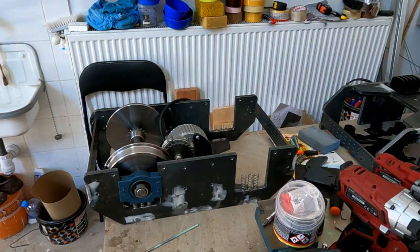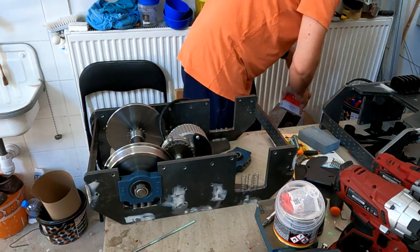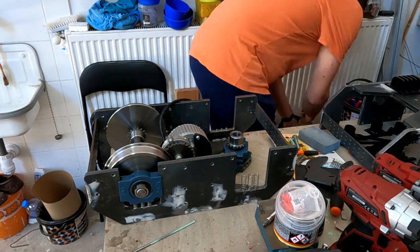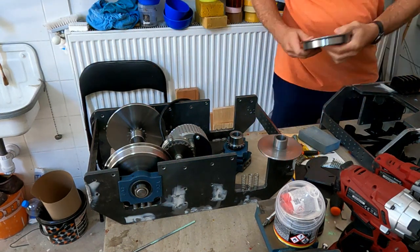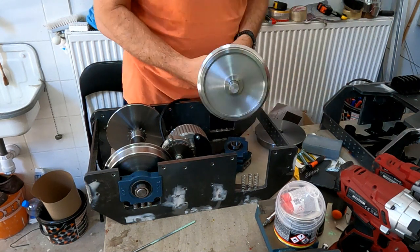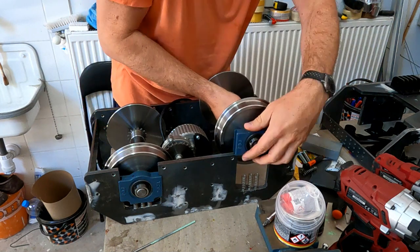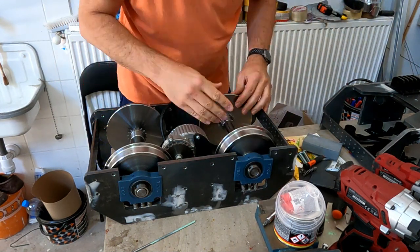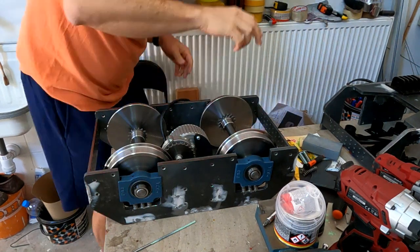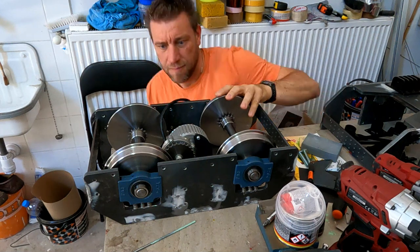At this point I wasn't even sure if the chain link length would be good enough. There is adjustment on the motors so I can move them around to tighten the chain, but I don't have control over the chain between the two axles since the axles are fixed and they move up and down. I didn't know if the chain would be just right or too loose. I think it is just right, but if one axle is fully compressed and the other is at full extension, the chain would be too tight.